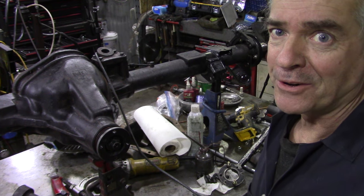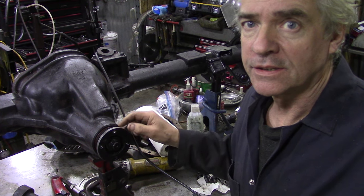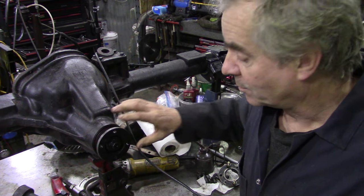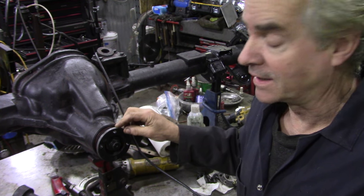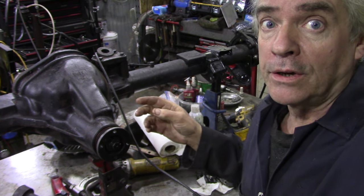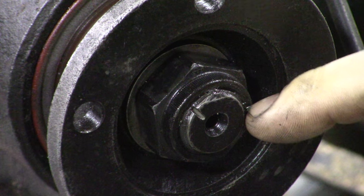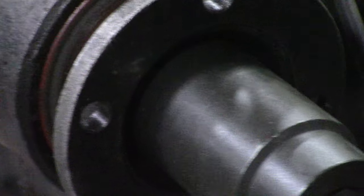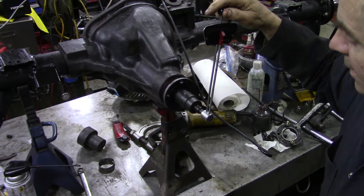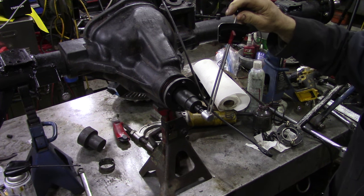This is the next day again because I had a lot of problems yesterday. To recap: JP put a speedy sleeve on this pinion and it's really nice now. One thing to finish off — this isn't the original flange, it's another flange. Was there a difference? Well, if we zoom in and look at the marks on the pinion and on the nut, you'll find they don't correspond. But we put the gauge on and checked the tension — it's showing two Newton metres to turn.